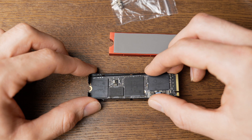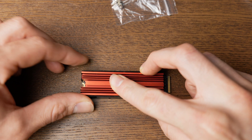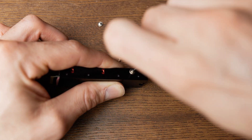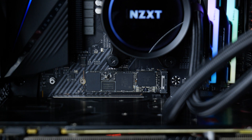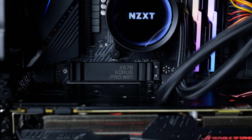So what can I say? I spent many days learning about NAND and how it works, and a whole Saturday doing this testing. The conclusion is that these heatsinks, used as intended, are technically useful for the controller but can actually be somewhat damaging to your NAND versus not using one at all. What you actually need to do is cool the controller and not cool the NAND — get small heatsinks and apply thermal tape only to the controller, not over the NAND chips. Personally, I'm going to try removing some thermal tape from the stock motherboard heatsink and only keep it on the controller.